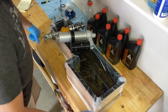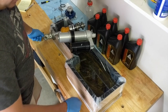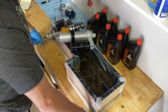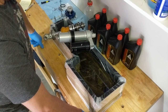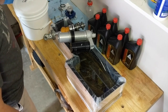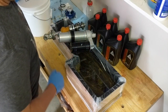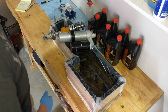A lot of people are going to say this is a waste of oil. I made this bleed box for 20 bucks in scrap wood from Home Depot, some caulk, and flex seal — which didn't work out so well — so I ended up putting plastic around the box as well to ensure there's no leakage. Yes, this bleed box takes about seven quarts of oil, but after I'm done the oil won't be contaminated because everything has been through the dishwasher and is exceptionally clean. I'll use probably about two-thirds of a quart to fill the shock and the rest goes into a sealed bucket to save for my other shocks.